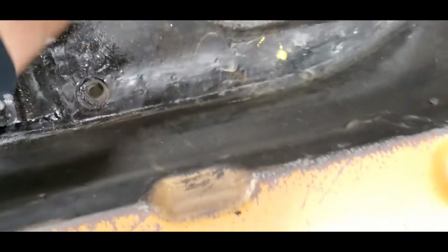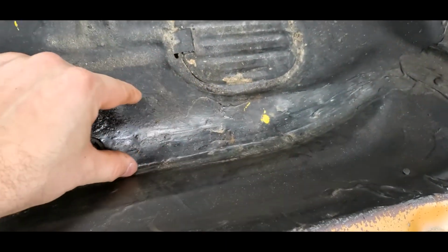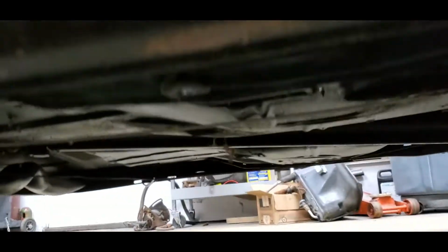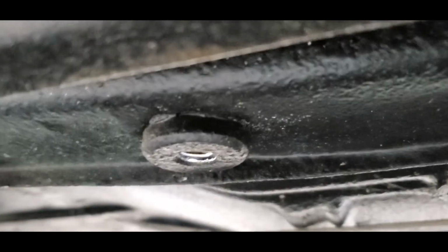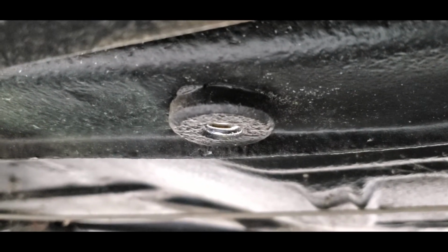This is the floor. The floor comes up to the seam, and then there's a brace about this wide that comes across the bottom of the floor. We'll see if I can get this to show it to you. So there's your seat belt mounting point for your bench. We're going to move that down through this brace 6.5 inches, and we're going to weld a nut right on to the bottom of this brace. And that brace is pretty thick.